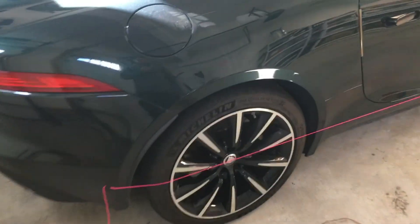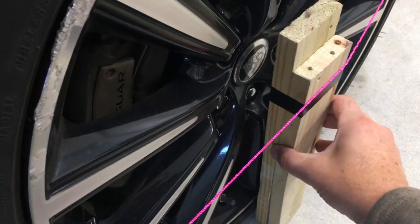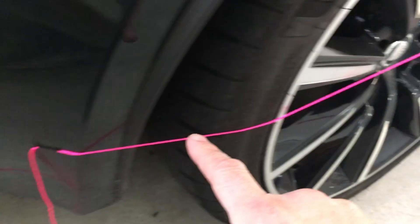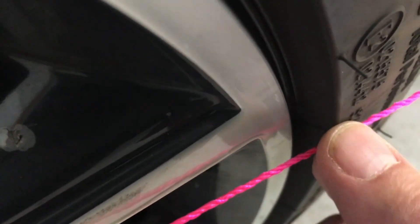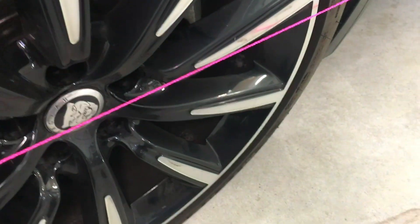Let's go to the other side and see how the other rear wheel is doing. On this side of the car we have the same arrangement at the front. We stand the stick up vertically. The string comes around the corner, kisses the tire there as the hard point, and then we look at the gap. It's off by about a millimeter — the string is just barely kissing the tire. So this tire is also toed in relative to this chassis line, which is where it should be for this Jaguar F-Type.